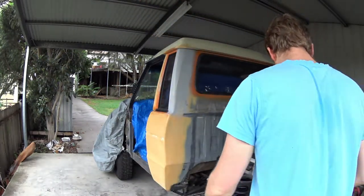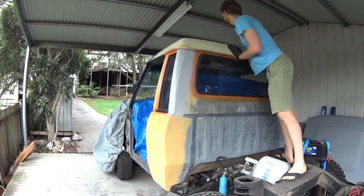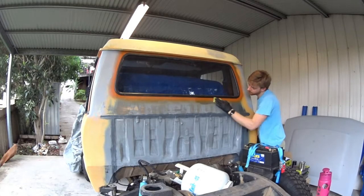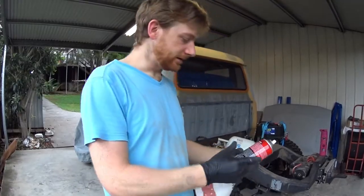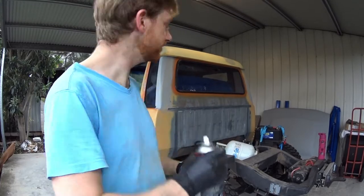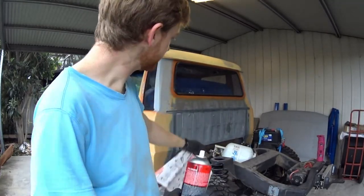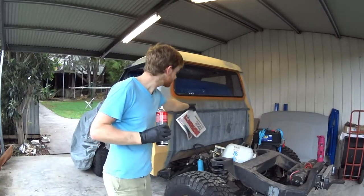Final wax and grease remover, to get rid of any last traces of oil. So the car is basically sanded down and degreased as best as I could before putting on the Raptor Liner. Apparently you need to cover any exposed metal and I've rubbed through in a number of areas, especially where, because of the amount of time, corrosion has come in, especially along there.